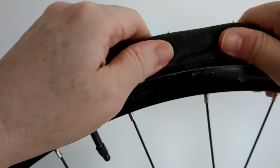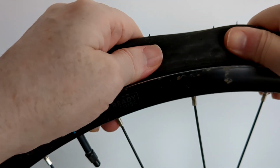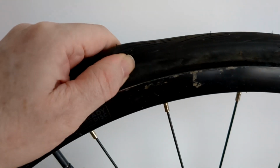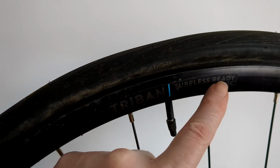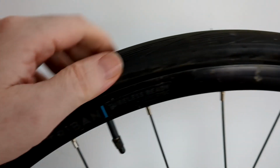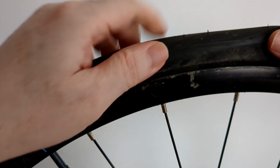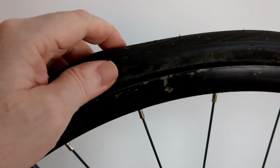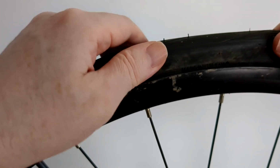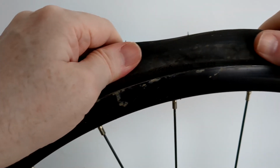And I say that because I've had two punctures, which I'll talk about later, and both times when I've been out in the wild, if you want to call it that, I've not managed to get the side off. This time I did, but anyone with that problem, I'll make a big thing about it now. For those that haven't used tubeless ready wheels, I think they're designed to be a tighter fit, and when you pump them up, you'll hear a ping, ping, and that probably means that at least one of your sides has moved into the groove, and it's probably airtight even though they use sealant for their tubeless tyres.